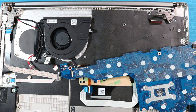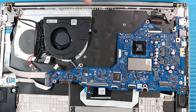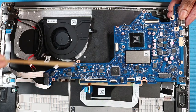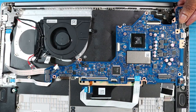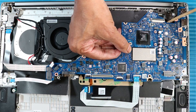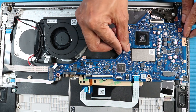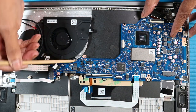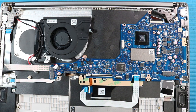Replace the system board. At the bottom of the system board, connect the following cables to their connectors: USB ribbon cable and fingerprint ribbon cable. Turn the system board over. Carefully route the external connectors on the system board into the cutouts in the top cover. Lower the system board into position on the top cover. Caution: Take care not to trap any of the cables between the system board and top cover. Replace the seven P1 Phillips-head screws that secure the system board to the top cover.